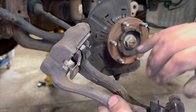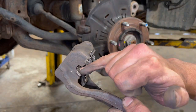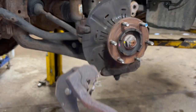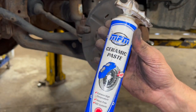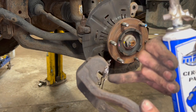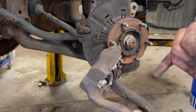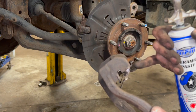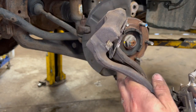The carrier is all cleaned up now — I took the shims off, cleaned well behind them, put the shims back, and cleaned the shims too. The shims are a little tricky to clean with their pegs and tight spaces. Now I'm going to use some ceramic paste rather than copper grease — you don't really want copper grease on modern brakes with ABS. I'll apply the ceramic paste to any surface where the brake pad is going to run. Doing this with the carrier off lets you get it on the back surface nicely without risking getting any on the brake disc.